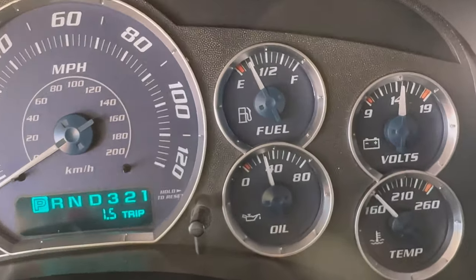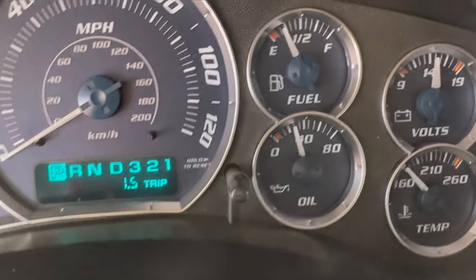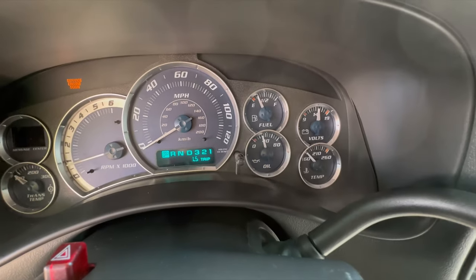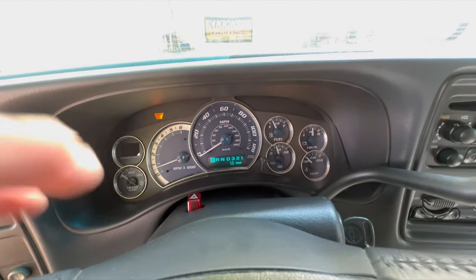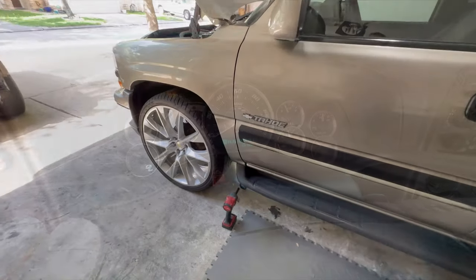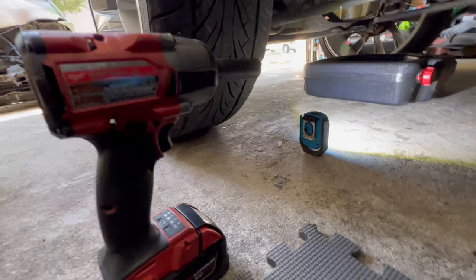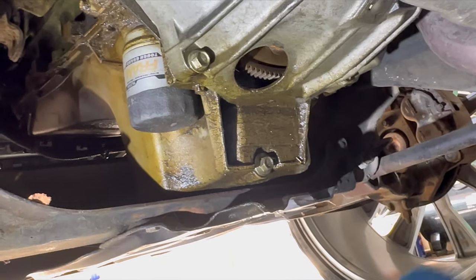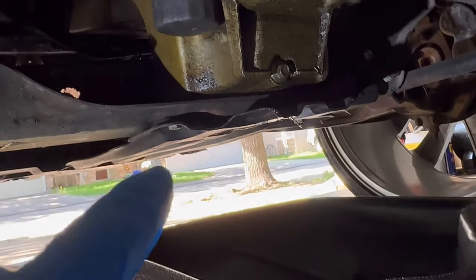I still got to do all that stuff, but I want to start off with the oil leaks. The pressure is at least better — before it was real low, almost zero — and whenever I step on the gas it does go higher now. I'm going to start taking this thing apart to see if it makes a difference, maybe once I also fix that check engine light with the tune-up on spark plugs and wires. First I'm going to drain my oil; it uses a 15 millimeter.